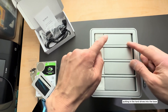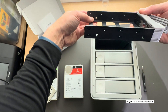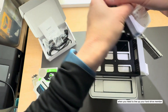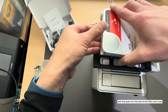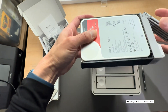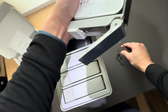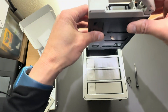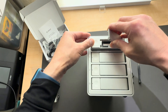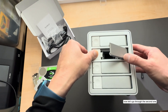To install a drive, you slide the lever and pull the tray out. This is not a tool-less design, so you have to secure your hard drive with screws — which are included in the kit. Line up your hard drive so the connector in the back goes into the notch area. Carefully slide it in without dropping it — you'll feel the hard drive engage the connector in the back. Once engaged, close the tray and it locks in.